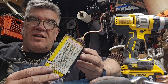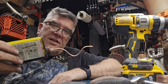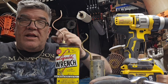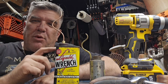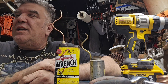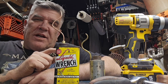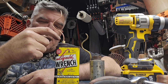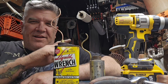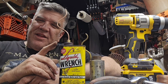There you go, Scott. There's your rig. I'll just pour a little on my rubber here. Look at that — slicker than all get out. So there's one way of doing it. If you're handy with brazing, I would just braze this right on, drill it super tight, push it in and braze it. But I don't have the right brazing rod. What I'm going to do is get a neoprene washer, lift this, put that on, and snug it back on — and now I'll have a second primer can for my second workbench. Thanks for tuning in, that was fun. I really appreciate it. If you got any other suggestions, let me know. Until then, I'll see you around.